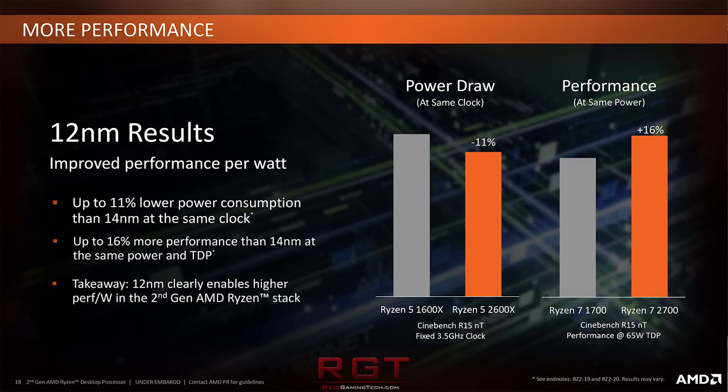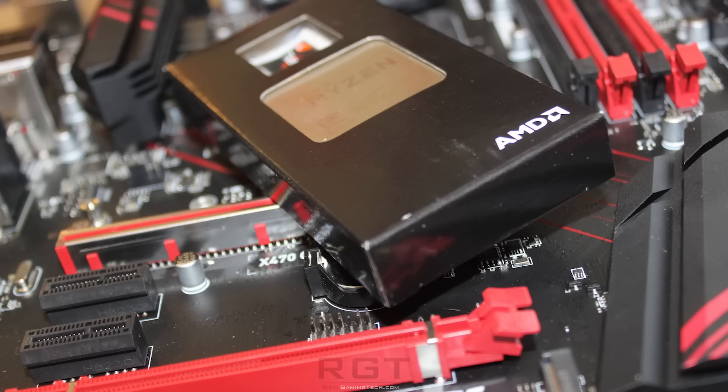But if you're the owner of a current and existing rig, and let's say you have a Ryzen 3 and your scenario has changed and you need those additional CPU cores, and you can't justify the extra expense on a motherboard, or you simply just don't want the hassle of taking apart your rig, do know that the 300 series motherboard will be absolutely fine with a Ryzen 7 2700X.